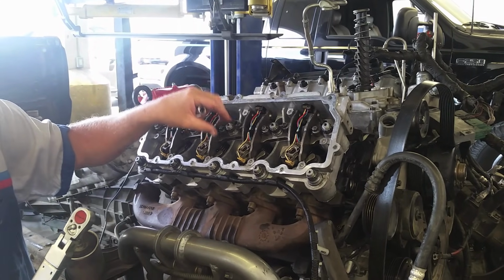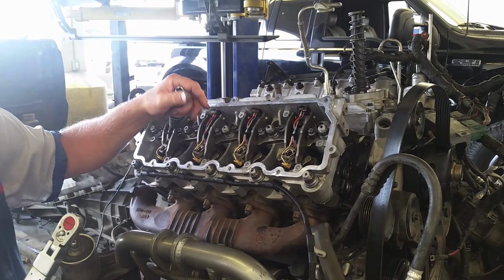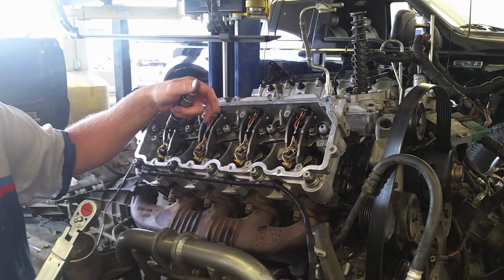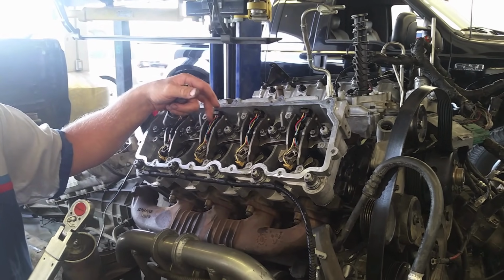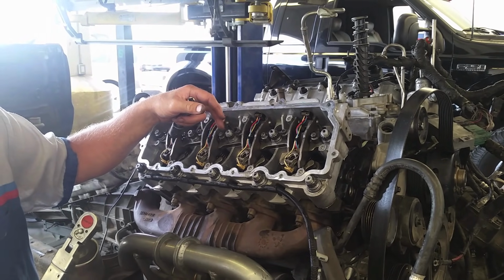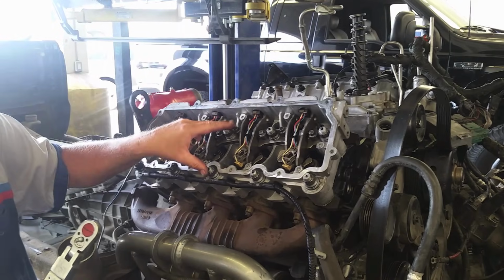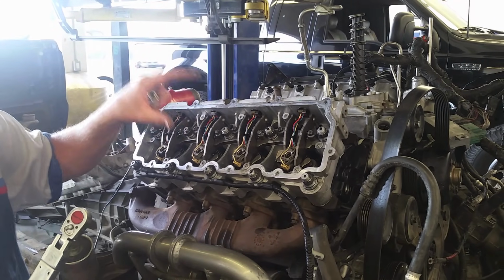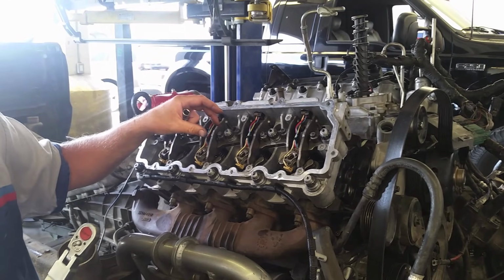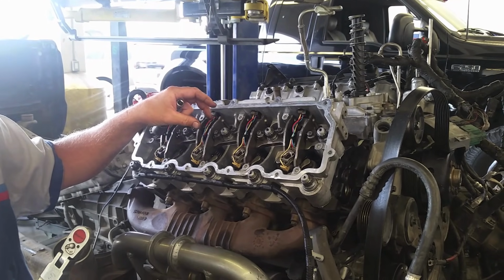And then with your regular head bolts, we don't see issues as long as the truck's not pushed. If the truck's pushed pretty hard, with programmers, stacks, towing, heavy loads, going up grades for 10, 15, 20 minutes, an hour, then yeah, we start to see head gaskets fail no matter what. You can do studs, the best head gaskets, O-rings, anything, they all still fail. You can't push it really hard and expect to tow with it and have everything nice.